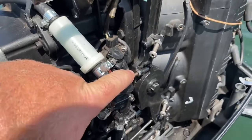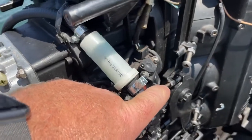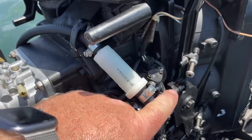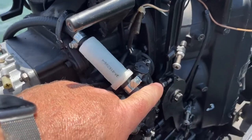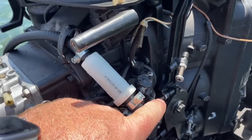What you want it to be on this engine is between 625 and 725 RPM. I've got the engine warmed up and I set the speed so when I go up and engage it, it is around that 725 mark.